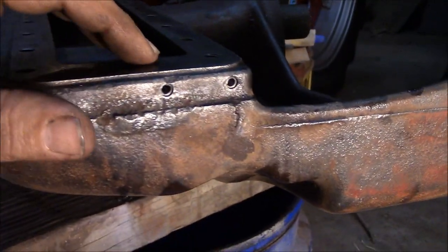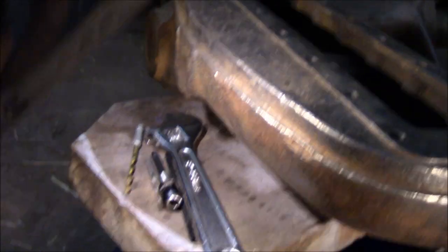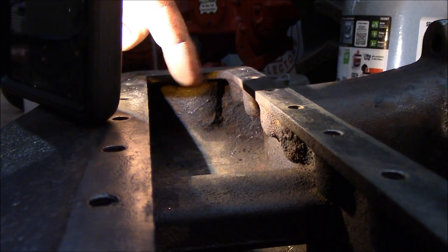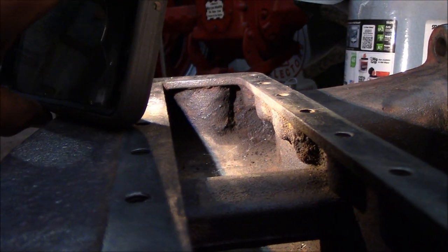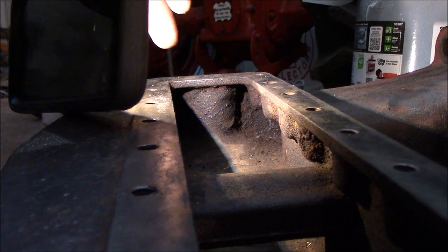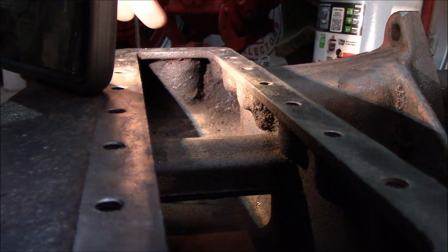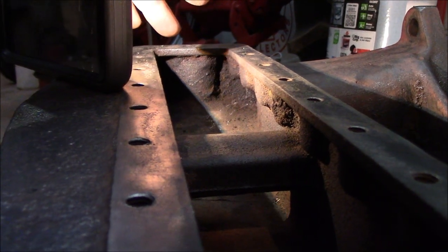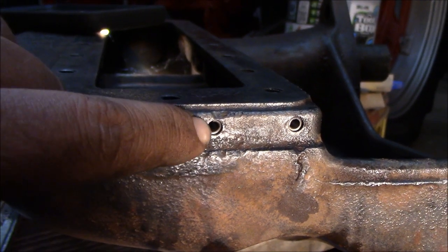People don't realize how critical this here is. As you can see in there, that little hunk right in here - that right there is where those screws come into. You have to be extremely careful when drilling, because if you drill into that, this piece is essentially just junk. You probably could fix it, but it's only more or less a temporary fix. If you drill into that, you're going to have antifreeze coming out these bolt holes. I have seen Cubs with antifreeze pouring out these holes where somebody had drilled them out and tapped them.